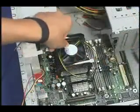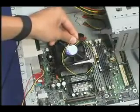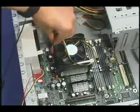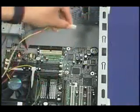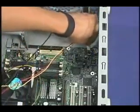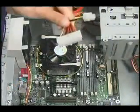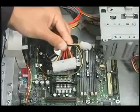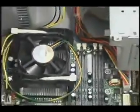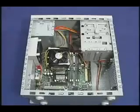Be sure to plug the fan heatsink power cable into the motherboard fan power header. Consult the motherboard manual to determine the correct fan power header to use. Also, be sure to plug in the power cable for the system chassis fan. Once the system has been assembled, 2 power supply cables must be connected to the motherboard for the system to operate. Following the previous steps will ensure that the boxed Pentium 4 processor in the 478-pin package is installed correctly